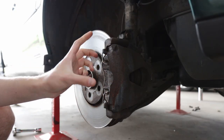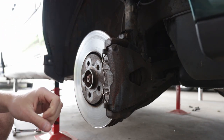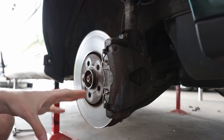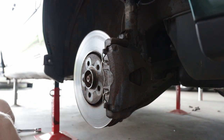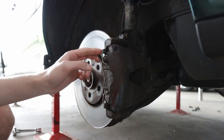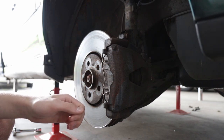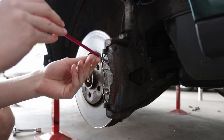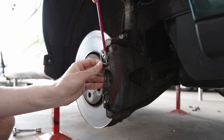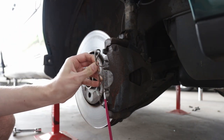We're going to start off here on the front calipers. Let's quickly go over some of the parts. I know a lot of people painting calipers probably aren't the most mechanically inclined — it's usually one of the mods that beginners do, so I'm going to bring this tutorial right back to the start. This right here is the retaining clip — it cuts out vibrations in the caliper. It's a pet peeve of mine when people paint over these. They're as simple to remove as putting a screwdriver behind, though it will have a bit of tension, so be careful of your eyes and make sure you've got glasses on.